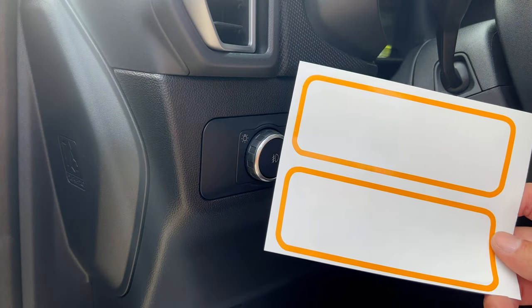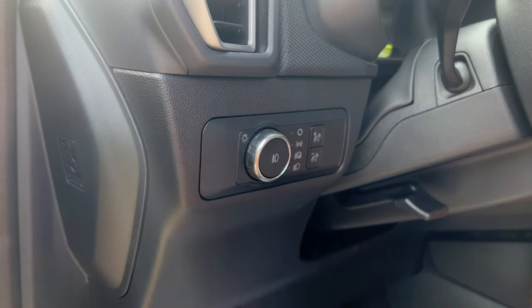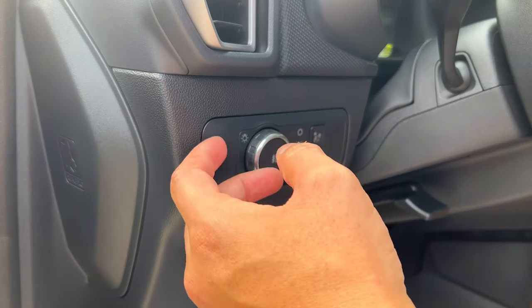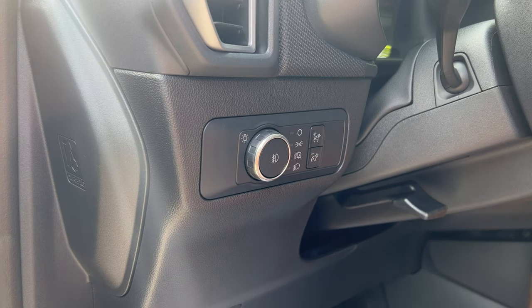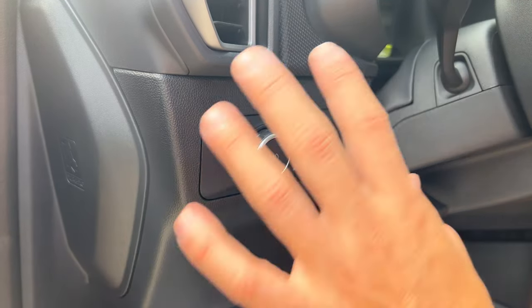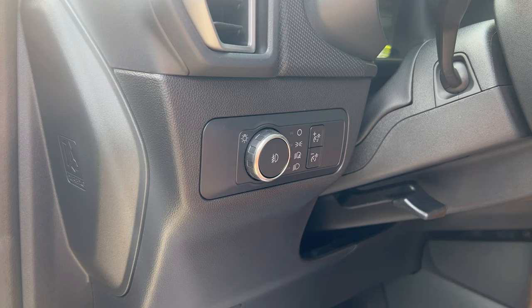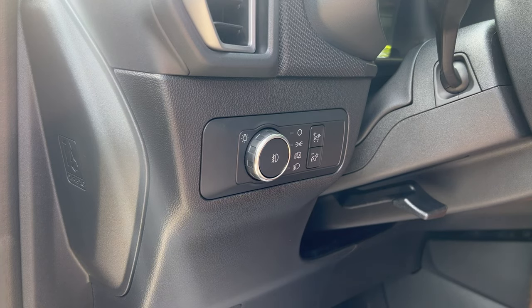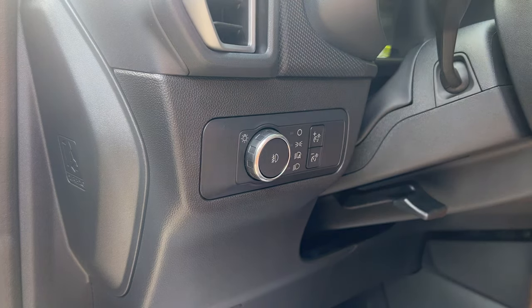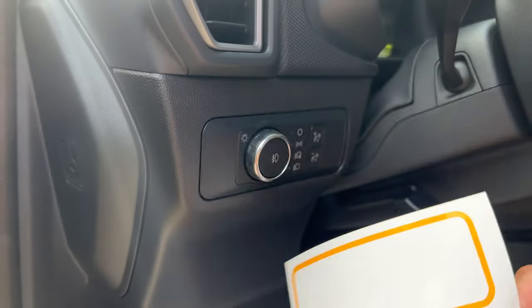So we have our two overlays — we're obviously only going to use one unless we mess up. You want to get interior detailer, something that won't leave a residue. You don't want Armor All or anything like wax on this because it won't allow the vinyl to adhere properly. Take that microfiber and clean this area off thoroughly. This is a brand new vehicle so it's already clean. When you're installing vinyl, you kind of want some Goldilocks type weather. The sun is partly cloudy right now so it's not really hot in this vehicle — it is currently 77 degrees.